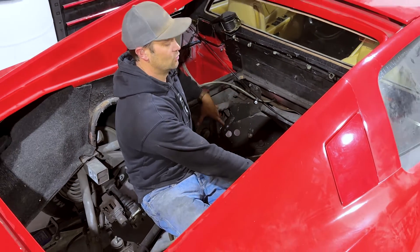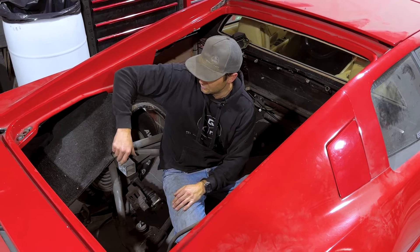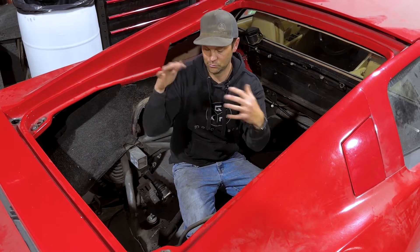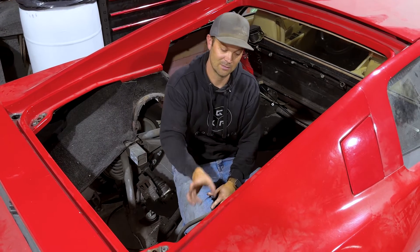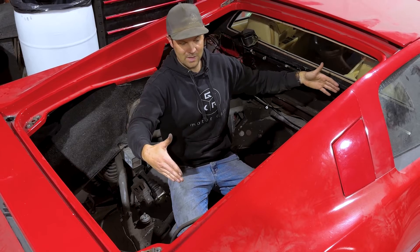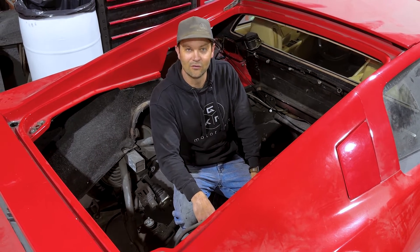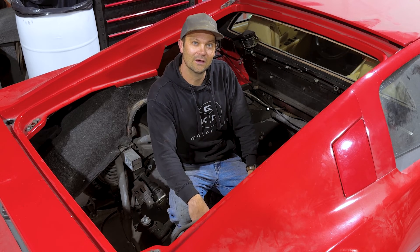Then moving onto the batteries. The motor cradle is pretty much done and now that we've got it in, we can see what area we're left with — there's actually a lot of room after the motors. The batteries are what take up the most room. We're going to bring two arms up and triangulate a little bridge to hold the front side of the batteries, and at the back there's a strong structural point to build some brackets. The whole battery pack — kind of a C-shape — will come down and sit over everything. That'll be the next episode for the Lotus — battery boxes and getting all that situated. Thanks for watching!